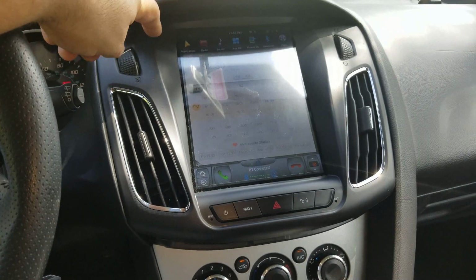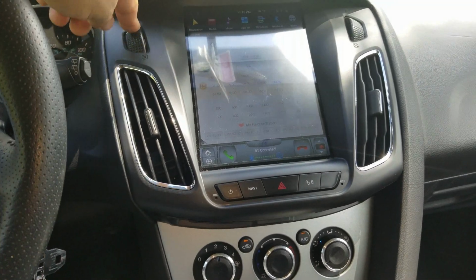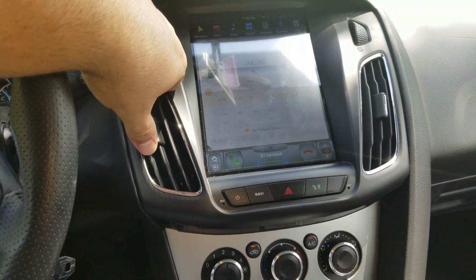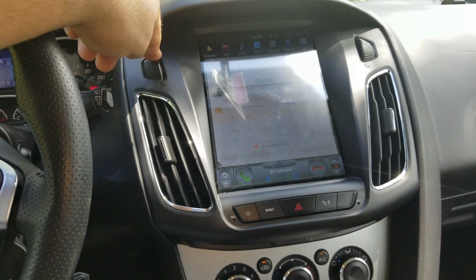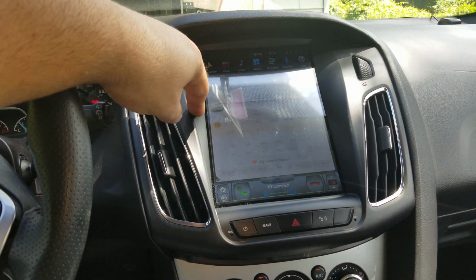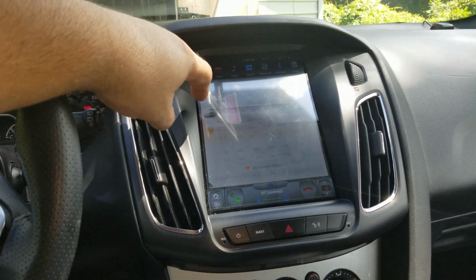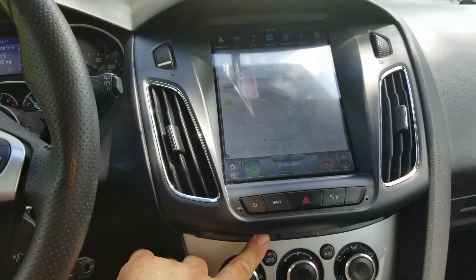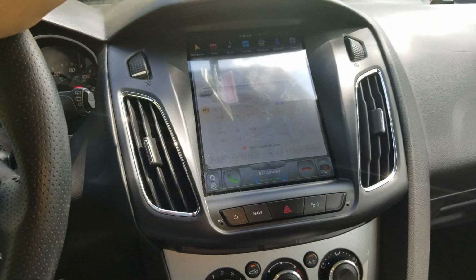Alright, so I'm also going to be working on the radio today. I need to take this out. Fix the actuators in here because the little ball joint popped off and now I can't do anything with this. So I have a backup if it's broken. I don't think it's broken. It's probably just popped off, which is dumb design. I also have to install some of the wires in here that will go to the new amp and subwoofer that I'm switching out. Yeah, so just have to take these two bolts out the bottom, and then the whole thing will pull out. So I'm going to get started on that as well.